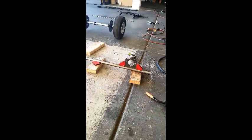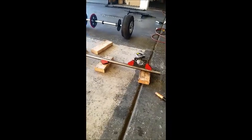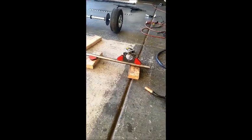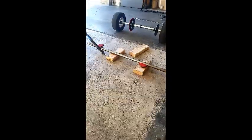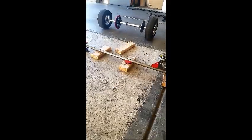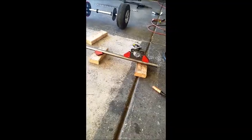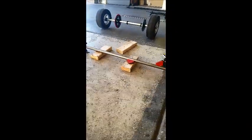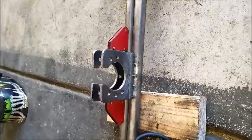I lined up the motor and I'm just not quite sure if I want the bracket to be underneath the axle or on top because of the motor placement. I'm going to go ahead and mount these up onto the extension bars tubing and then further line it up once I get the axle on. I'm going five inches from the end to give me a little bit on the end to make a bumper, and plenty of room on the front to line up the rest of the axle. Got one tacked in, going to do the second one.